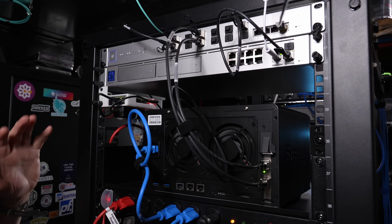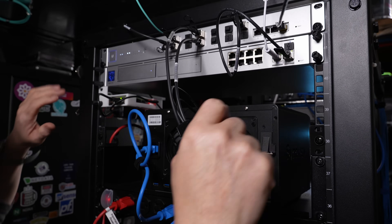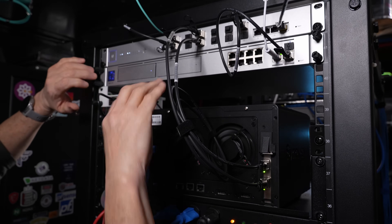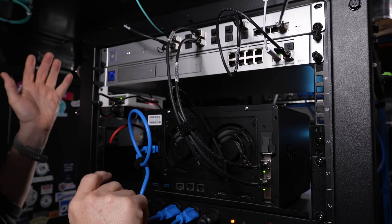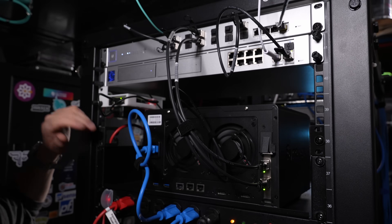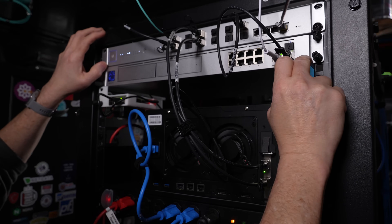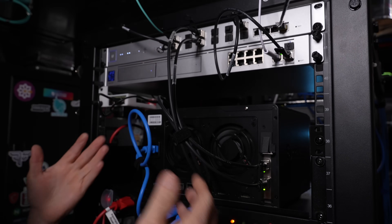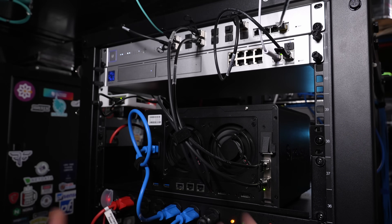For convenience on both of these racks, I utilize the backside of the rack — so we're actually standing behind it right now. We have this UniFi Switch and then this is the actual UniFi Dream Machine that runs my network right now. I recently did a video talking about swapping that out from what I used to have, which was PFSense. This is the internet feed that goes up and over behind me to a standard cable modem box — unfortunately we don't have fiber where I'm at. The UDM uplinks at 10 gig to this, and here are lots of DAC cables. Here's a Synology I have sitting back here — this just has some backups on it, and I use it for test scenarios, including replication from Synology to Synology.